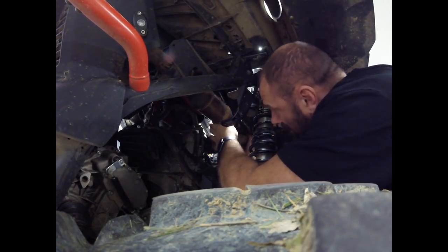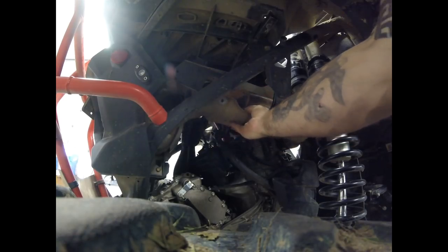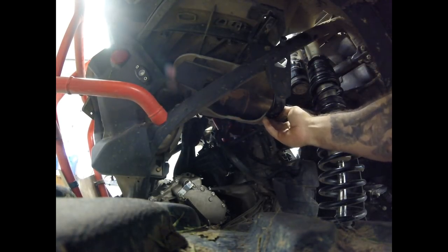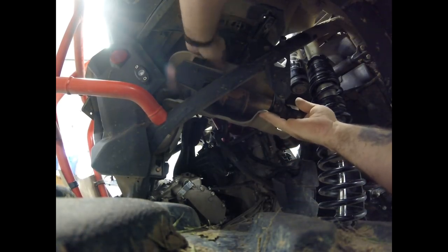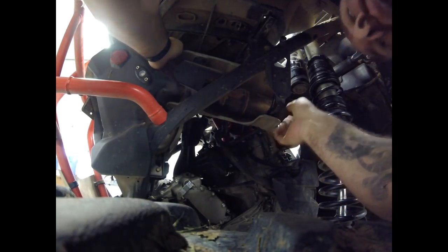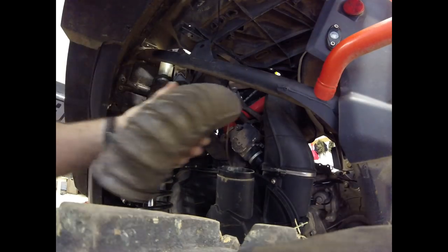After you get that all tightened up and your tube from the blow-off valve connected, it's time to put your exhaust back together exactly the way you took it apart. I'll show you in the next video how to do the cat delete — it's really easy. All you're going to do is find something around the shop to drill it out. I actually used a long wooden drill bit, and the reason I used wood is I was holding the exhaust in my hand while drilling — I didn't want a steel bit to come through. The catalytic converter material is not very hard, so you can get away with a wooden bit. After that, use a chisel to knock out the sides.